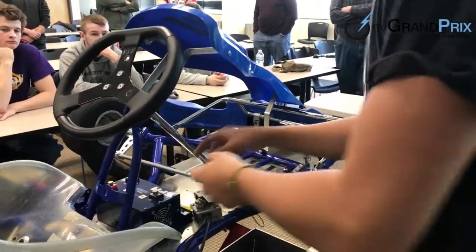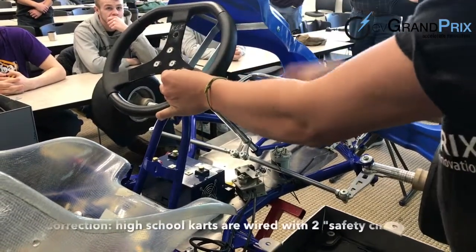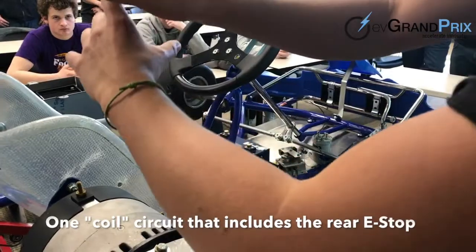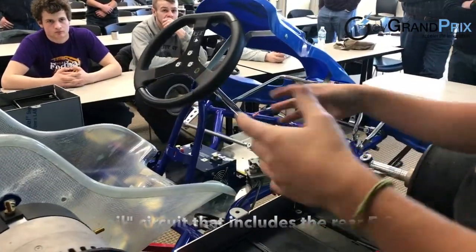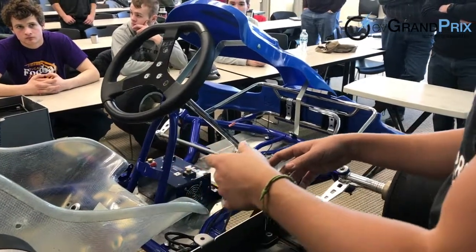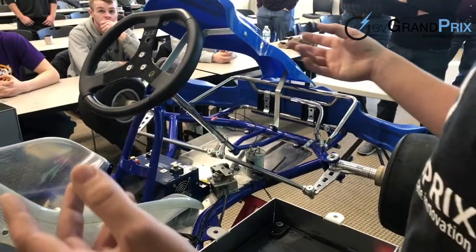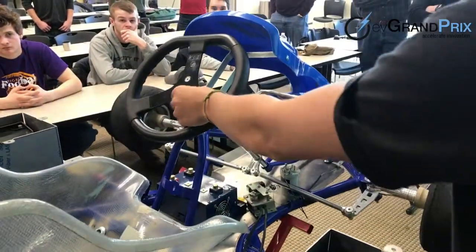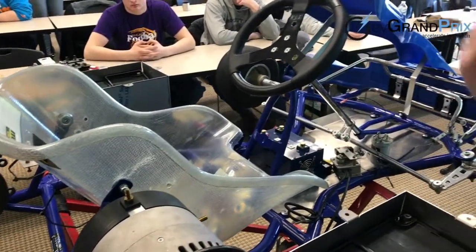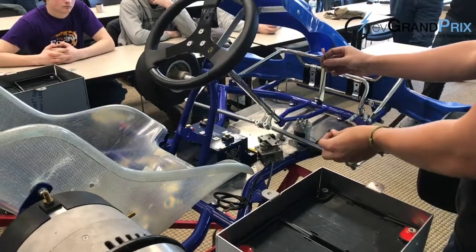The circuit runs up through here, through your on switch — one or two switches on your cart. It'll run through the back, go through the emergency push-button off switch, come back, and then go to the controller so the controller can have the final say whether the contactor is on or off. So if any of the three systems in series — the on switch, the emergency e-stop on the back, and the motor controller — if any of those ever open, deactivate, or break connection, then this coil will no longer have 48 volts across it and you'll isolate your battery pack.